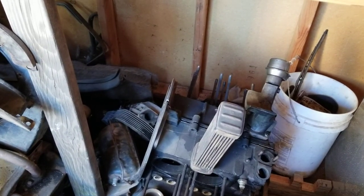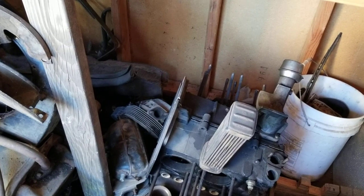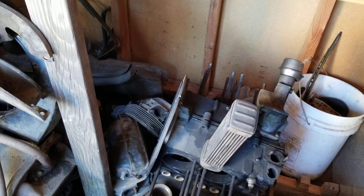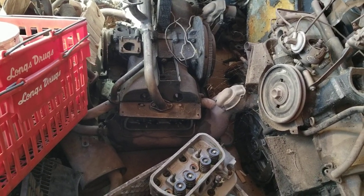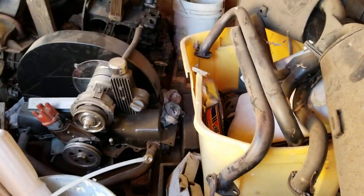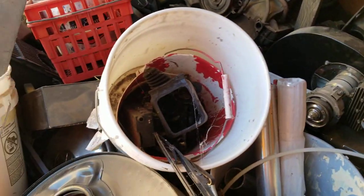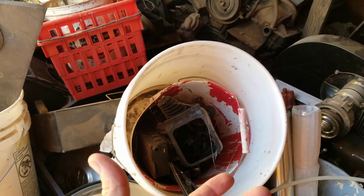Of course, if you're looking at stuff like engine tin, remember, always run the extra type 3 engine tin on the bottom of your engine. Guys will say that does not work, and I definitely have tested it, and it does work. It does make your engine run cooler. See if I have a set here. I can't find them, but it's the cylinder tin that goes underneath.